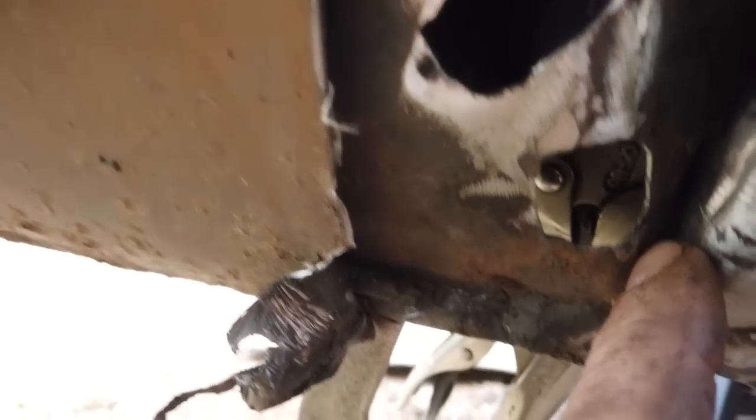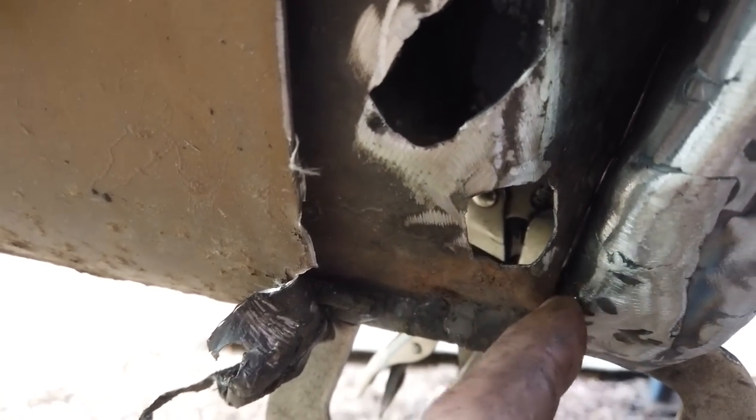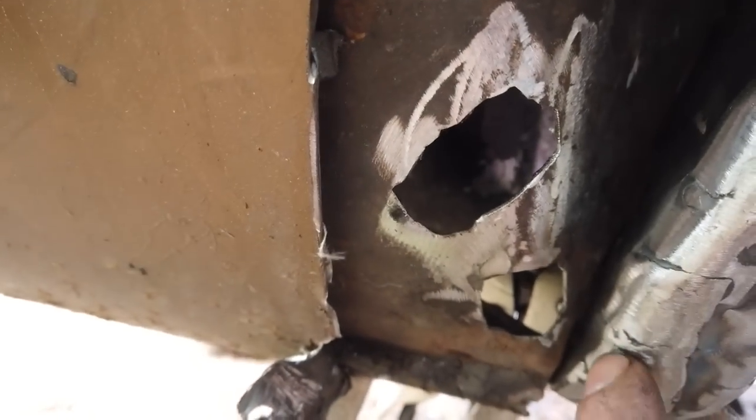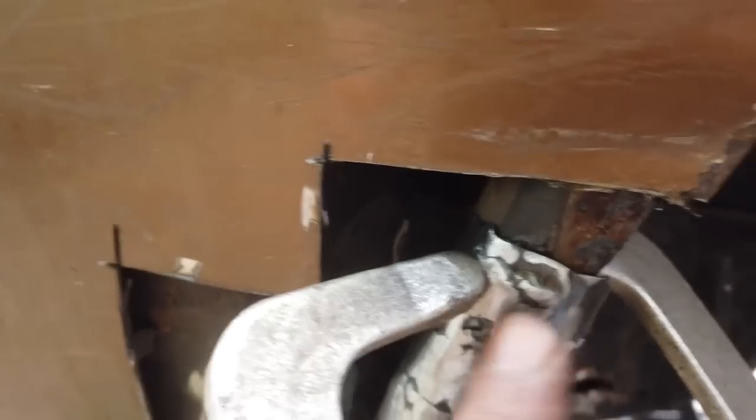It attaches to the inner quarter, the inner quarter panel lower. It attaches there. I had to break the original spot welds when I took the rotten metal off. We'll just weld through there. Two patches, weld that on, go along on the top, and then plug weld two or three plug welds down the bottom, and that section fixes the tub, doesn't it, Smokey?